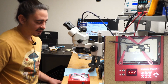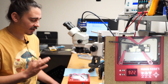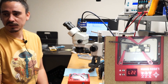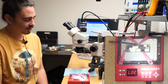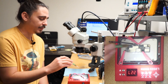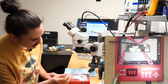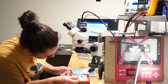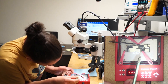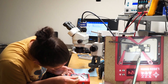The temperature is at 226 and still rising. As long as it continues to rise I'll let it go on its own, but if it starts to drop I'll supplement with hot air. Around 235 it should release and allow it to split. There are a lot of big ground pads holding this one together. It's going back down to 226 — this heating platform has trouble reaching that temperature and it's just not quite enough to let it split on its own.